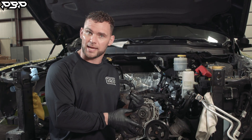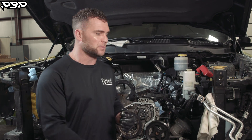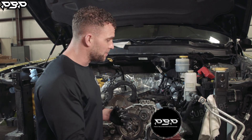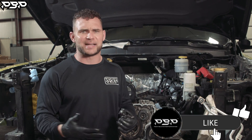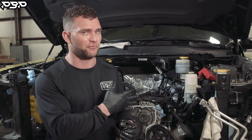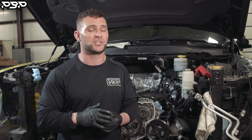Can you order a Wehrli solid tappet solid roller kit and put it in this engine? Yes you can, nothing wrong with that. Why do we go with Hamilton? We wanted a bigger camshaft profile — nothing more than that. Will putting this camshaft in make the truck sound cool like a gas engine? It will change up the sound, but it's not going to be dramatic — put a big set of injectors in there and off you go. If you own a Cummins 5.9 or 6.7 fifth gen, let us know in the comments — does the camshaft really make that much of a difference in the driving experience? Like and subscribe, stay tuned because we've got more fifth gen action coming your way.